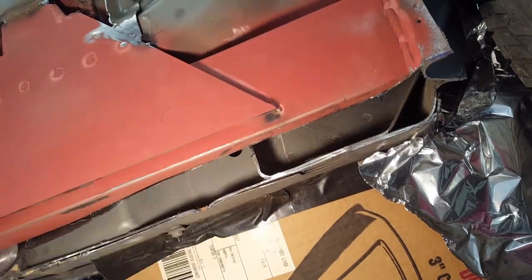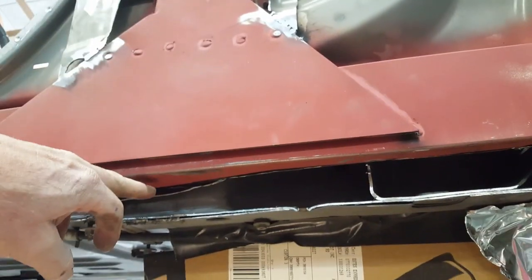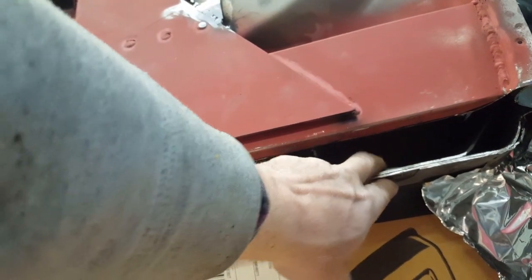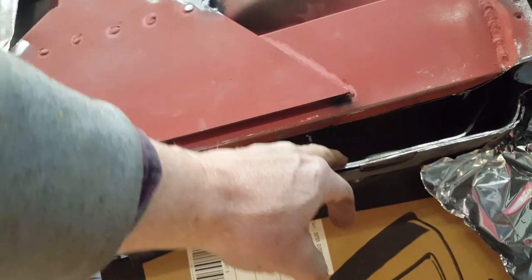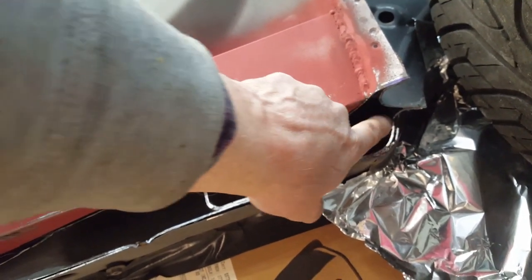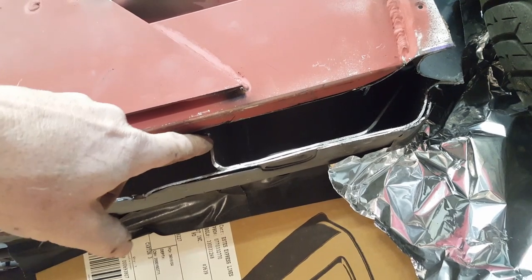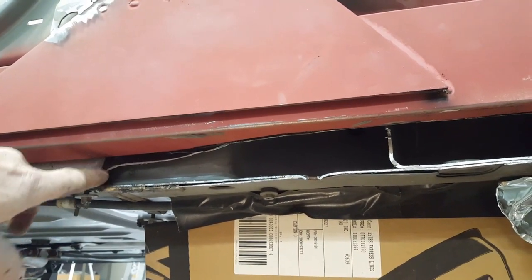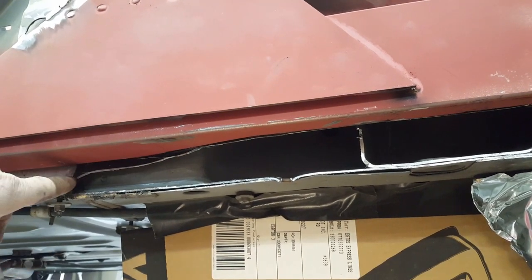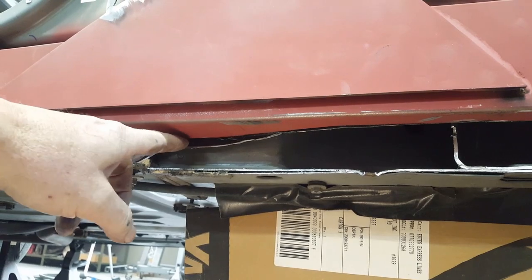You can see what I was talking about - there's a lot of strength. There's this member here across and up, and this is all double-walled over here because this is the jack point right here. You see this over here - this is where you usually have a little bit of a jack stop sticking down, all doubled up. It's very complicated over here to cut through. Using the Sawzall you'll run into all of this stuff in the back. You have to figure out where you want to make your cuts with what tool at what time.